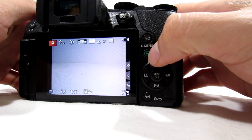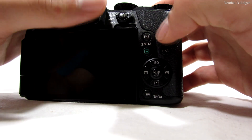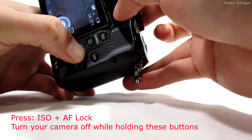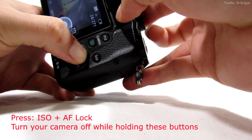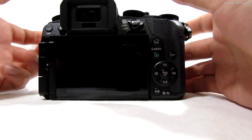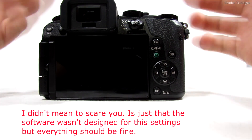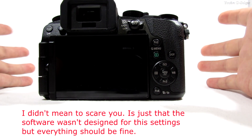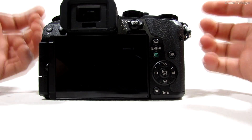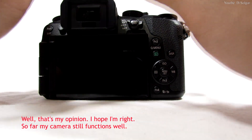Now press the green replay button again. Next, press the ISO button and the autofocus lock button while turning the camera off. You'll see a yellow triangle with an exclamation point — that means there is an error warning. It's not that something went wrong; the software is just letting you know that some changes were made and the camera may function differently. We are not damaging the camera; it's just that the software wasn't designed for this setting.